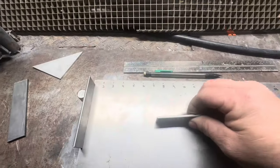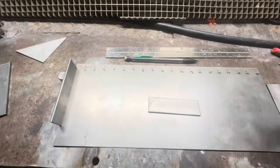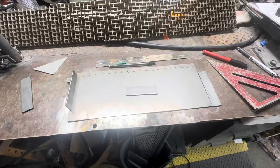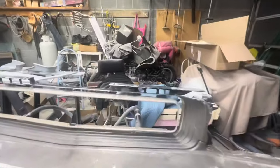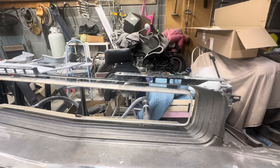our bump jig. So now we'll just be able to set it up there and lay the plate to it and then tack weld it. So we're going to get that going, and I'll show you what it comes out like. Also, when I say welding, we're not welding a flat sheet behind this because air still has to get through that. Because that's how the radiator stays cool.